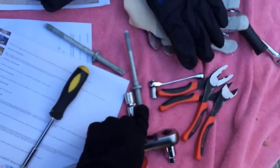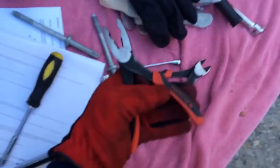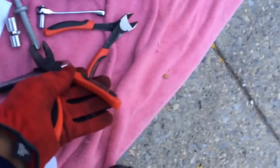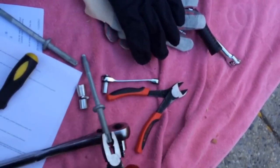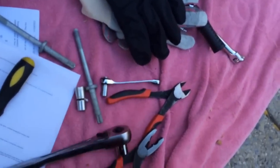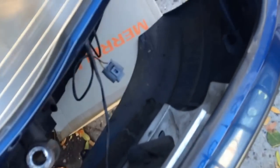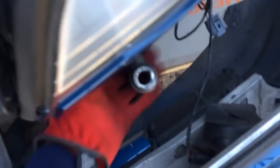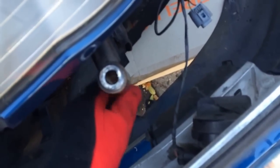One more thing — these don't come out right away once you loosen the bolts. You're going to need pliers to grab it and yank it out from the bumper. You have to yank it down or it'll just stay in there. It's really hard to get out after you unscrew it, so just yank it out with pliers. Once that's free, you don't even have to disconnect your horn. That's the connection for the fog lights, and that's actually the hole that those 9mm bolts screw into.